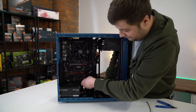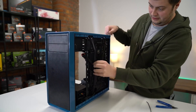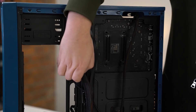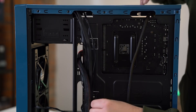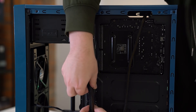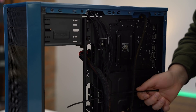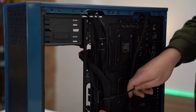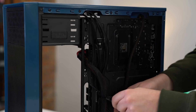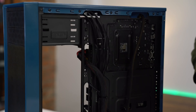After you've plugged in your cables, you're going to want to feed them through the cut-out holes that you see all around your case, and that brings them all out towards the back. I've already cable-tied some together at the bottom there just to keep them in place. I've stuck tie bases where I want the cables to run, and I have the front panel wires hidden underneath by the large 24-pin connector wire. We want to bunch them together — that's why I've tied this here. Simply tighten your cable ties and make sure they're all how you like them. The whole point of this is to make it look like you've got one solid cable coming out the back rather than a massive clump of mess. These tie bases are sticky-back and will go wherever you like.